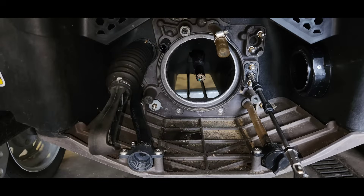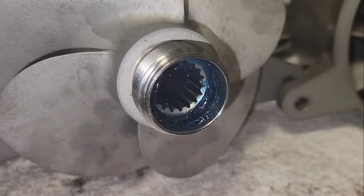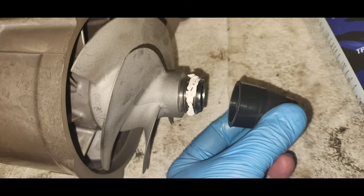When you finish cleaning up or replacing your impeller, take a few minutes to lube up your drive shaft and impeller splines with triple guard grease — that makes reassembly easier and prevents corrosion on both. Apply Loctite 572 on the impeller nosecone threads and install the cone. It is typically reverse threaded.